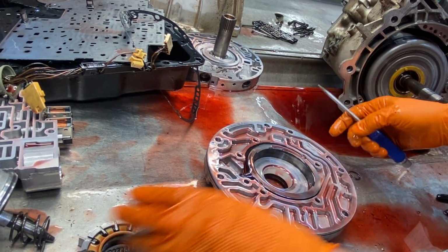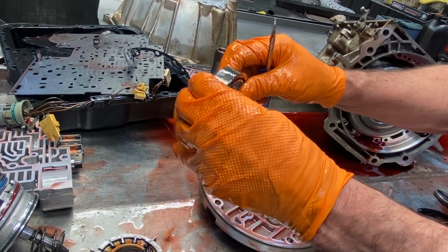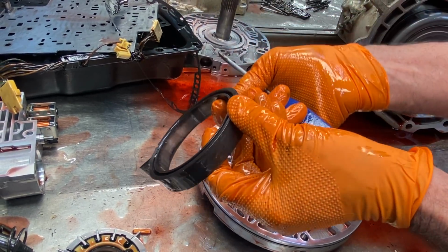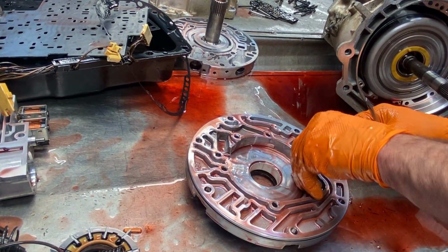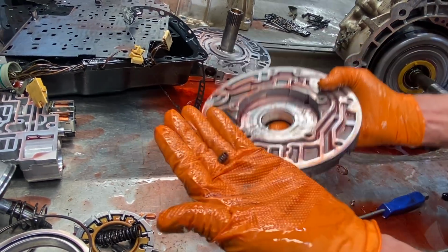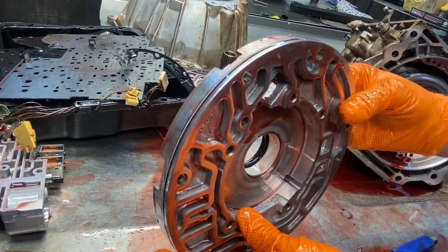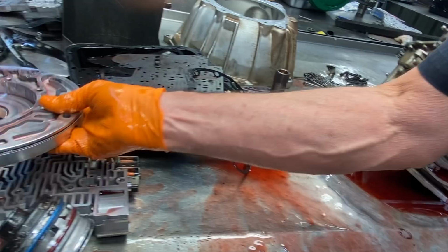Dual pump slide spring. That pump slide, of course, is worn plumb out. It's down to no bluing at all, hardly. Look at that. But as long as the body's good, looks really nice. Check your pin for your pump slide and your spring. It's still there, so we're good there. Bushing looks like it's never been used. Those are really slippery bushings, though. We put a black one in there that's really slimy too. We always glue our seal in though. That's a must.